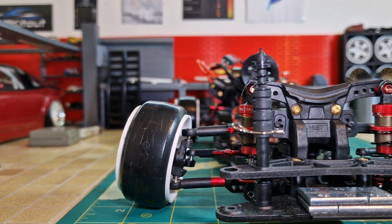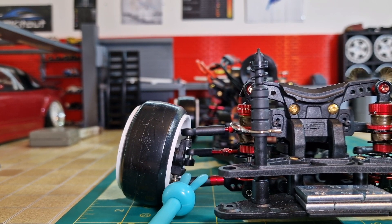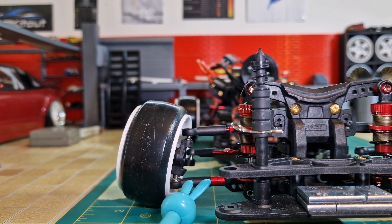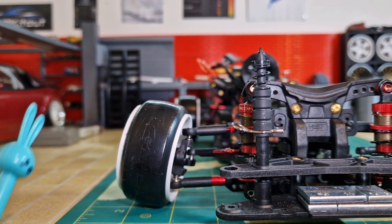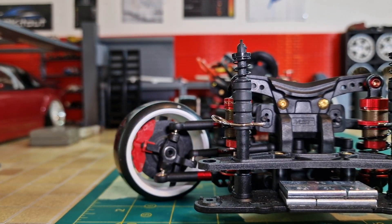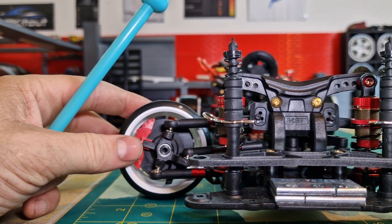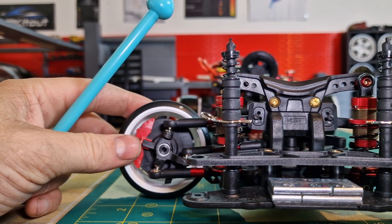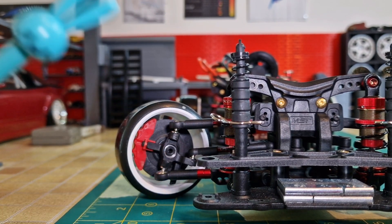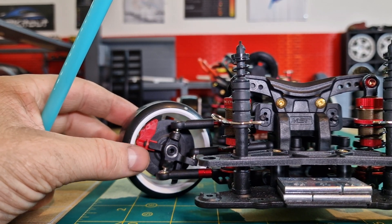The two main reasons for replacing these hubs: the first is this little part where the hub protrudes — I've actually shaved it off because it was coming into contact with the lower arm once I had more aggressive camber, which leads to better lock. The second is this pin here. That stopper connects to the lower arm and stops the wheel from over-rotating, and these plastic hubs will actually flex and cause the wheel to come into contact with the upper and lower arm, stopping the wheel from spinning and creating a braking effect.